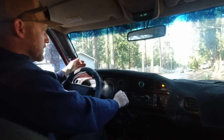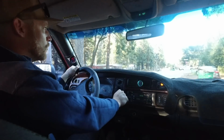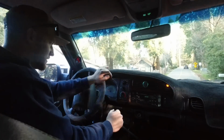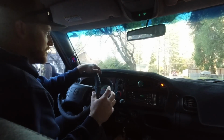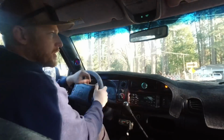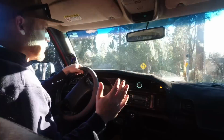And great oil pressure. I do have level 6 unlocked on the Edge, which turns this thing into something I didn't know 24 valves delivered, to be honest with you. It feels like a common rail with a Smarty tune on it. It wants to get up and go. One nice thing about these early Cummins engines is they're not based on RPM to get horsepower and torque. They're old school in a sense because they have the low end grunt, and it feels like it wants to slip the clutch at like 1500 RPM because it's letting that torque come in early.